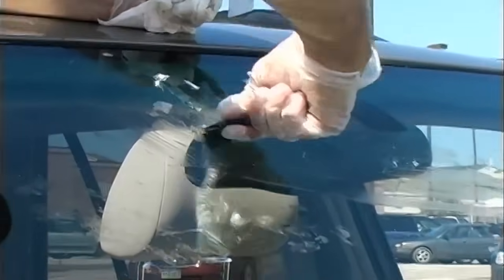If you don't have sunlight, you can use a cure lamp to cure — and in the evening or on cloudy days, that's a really good idea when it comes to cracks. You want to make sure they're good and cured before you let the vehicle drive away.